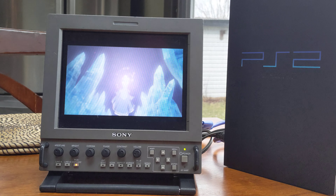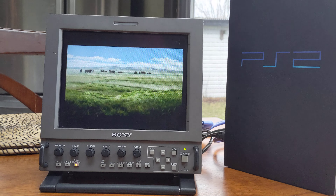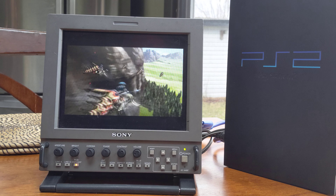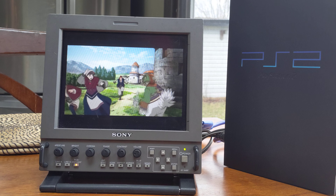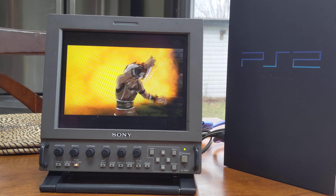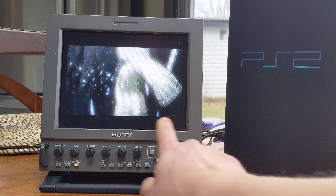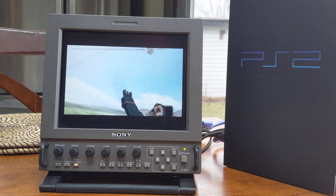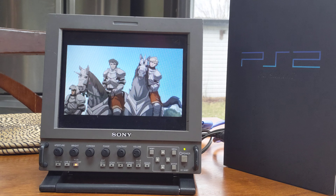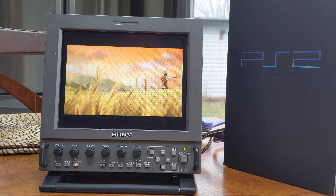For example, on old consoles like the NES or Sega Saturn, if you hook them up to a CRT TV, the CRT will process whatever signal it's given — whether it's 240p, 480p, or 480i — and you'll get a picture. But if I try hooking the NES up to this LCD, I actually won't get an image, because the TV de-interlaces a lot of the signal and because the sync is off, it won't display a picture. A better example is the Sega Saturn — what you'll get is a constantly changing resolution. The image will go off and back on and it looks like something is wrong. What happens is the Saturn changes resolution on the fly: the boot-up menu might be a different resolution than the opening FMV, which is also a different resolution from the game itself.